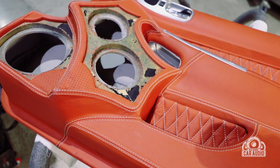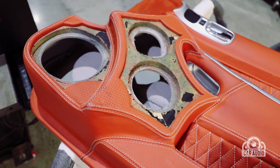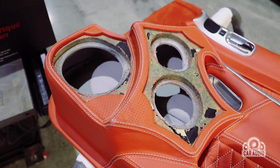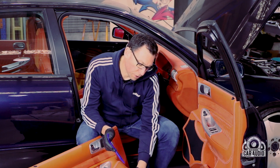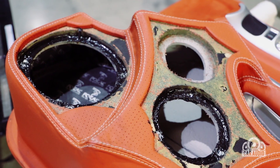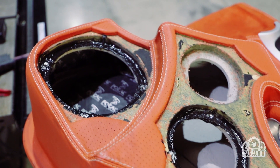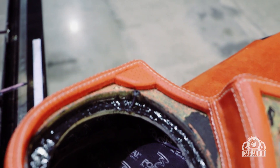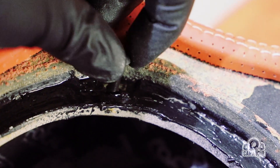This MDF that's been used is quite old but also a really low-grade MDF, and as soon as I started to do any drilling into it it just turns to powder, so there's no way we can use the bulk of it to secure a speaker. I've had to grind some of this away, router it out, and then put a lot of epoxy in and bed in some T-nuts at the back, all in epoxy, and that has been quite stable and worked really well to hold the door.